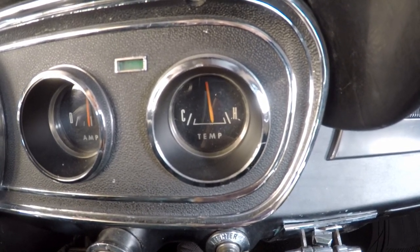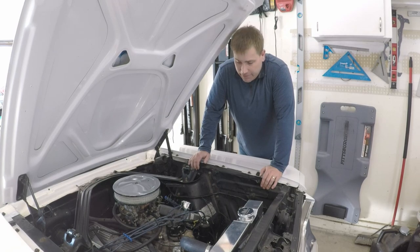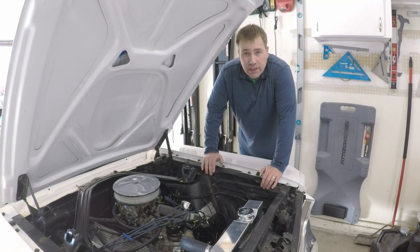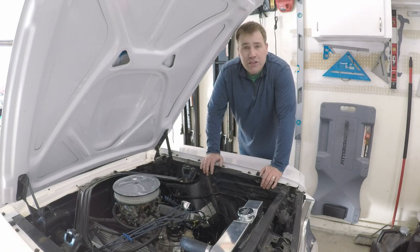The temp gauge is working now — it's been running for a while and we're looking pretty good. That worked out well. We were able to get the new water temperature sensor installed, which I didn't even know we needed but figured that out along the way. Got both gauges working. Found what looks like an air temperature sending unit in the back of the manifold — it wasn't sending the signal the dash was looking for, so I'm just going to leave it plugged in and we can take advantage of it later if we need to. Other than that the car's ready to go, all the gauges are working. Thanks for sticking with me — we'll see you in the next one.